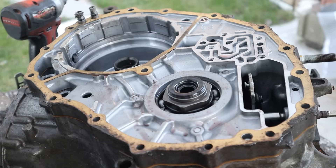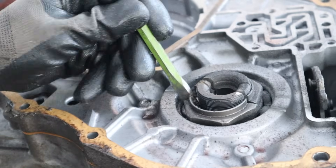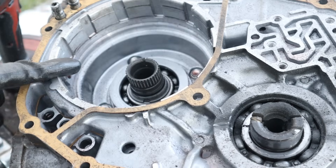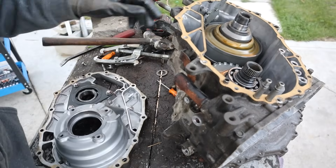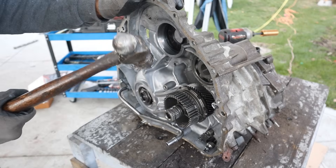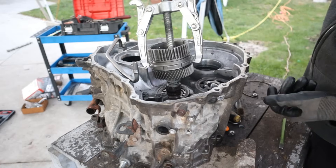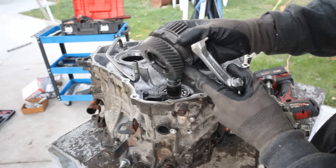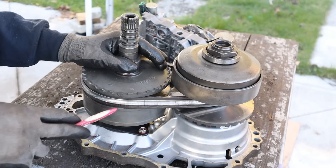I'm at the point where I'm supposed to split the casing, but this one is really stumping me, so I'm going to have to remove this giant nut with my 54mm socket. I also need to remove the bolts that hold the resolver onto the input variator and pry the rest off. I finally got the variators out — the trick was I had to shave down these edges with my grinder so it could fit inside of this little groove properly, and then it would come out.